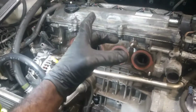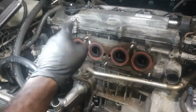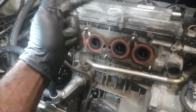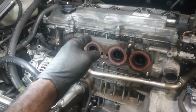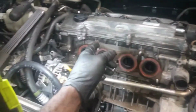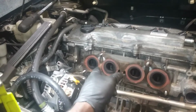The rings will seize up, be built up with sludge, and the oil will bypass those compression rings and enter the combustion chamber and get burnt off. In combination with inevitable oil consumption, you've got the PCV system. It does have a new PCV valve up there when I looked at it, so that's a good indication that somebody tried to remedy the oil consumption issue with a new PCV valve.